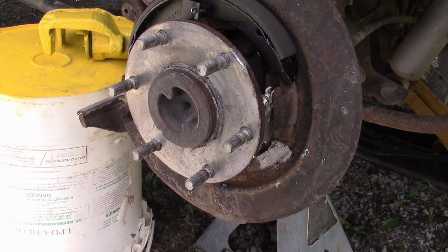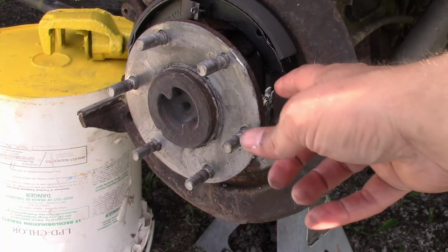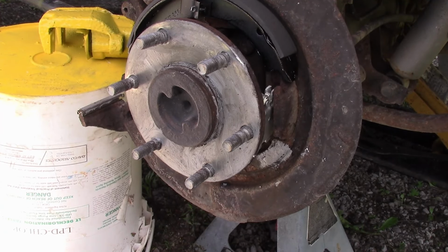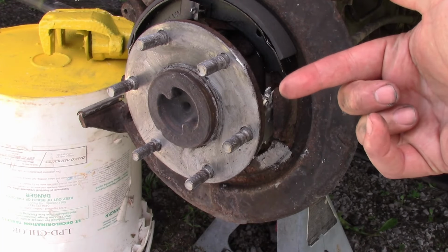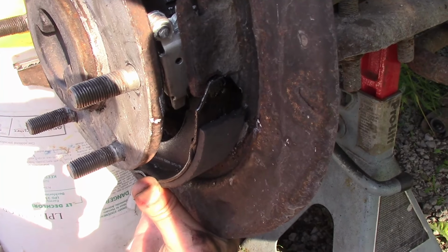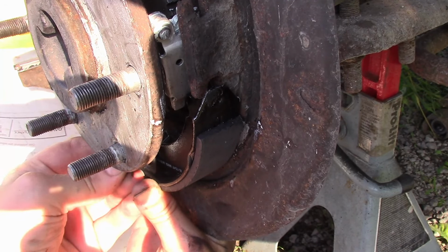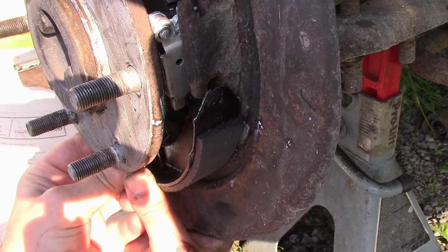Now if you were to pull that parking brake in again without installing the rest, it could drop out again. But with the parking brake released, that cable is pushing out and holding it there in place. Okay, here I'm doing the same thing, and I'm trying to do it all with one hand because I'm going to need to use the pliers on the other hand.